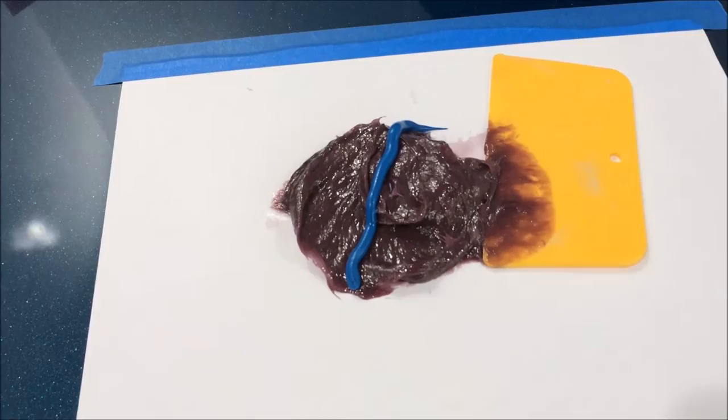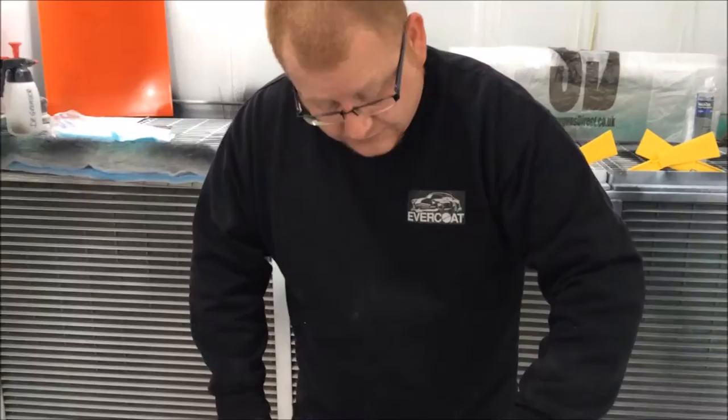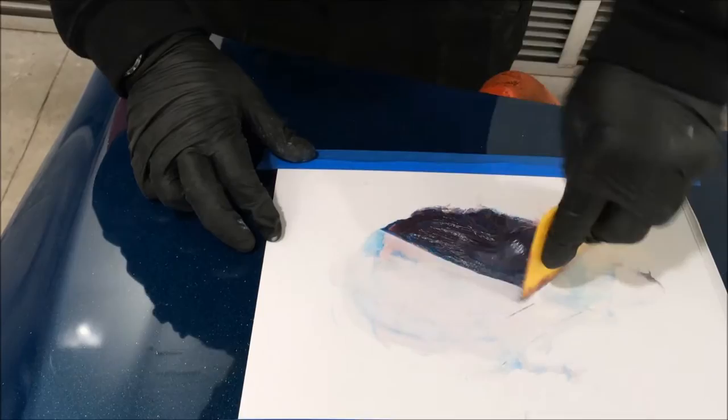What we'll do is we'll apply this onto this piece of sheet steel here, Matt, because I think for most of your applications you're going directly onto mild steel or low carbon steel, yeah? Ideal for after welds, for instance, smoothing off any tailgates, blending wings together, and so forth. You want a product to go over those welds. You can get it fully bang on, but you still run the risk of shrinkage, and of cracking on those areas. And you need something that's going to cover your back.